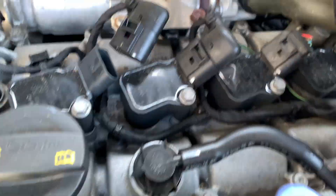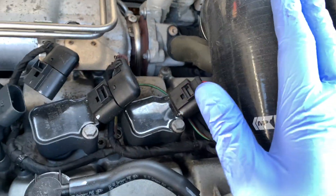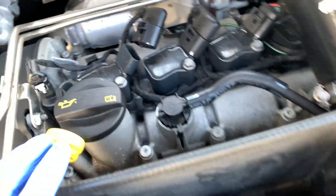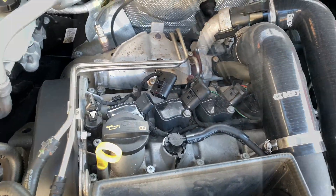I'm going to move on to plugs 3 and 4 — they are exactly the same procedure. But like I said, you do need to remove the original airbox if you've got one, because this pipe here is blocking the plugs, which I'm going to have to remove as well. This is an aftermarket kit. So that's how you replace the spark plugs on a 1.2 or 1.4 Mk7 Golf TSI.